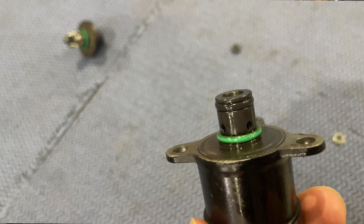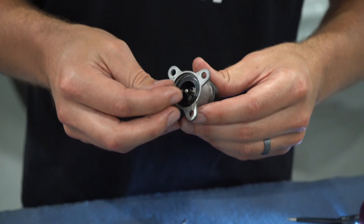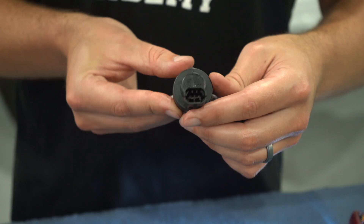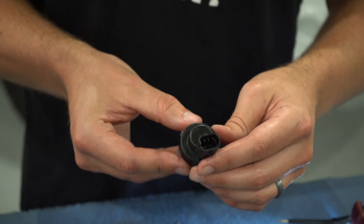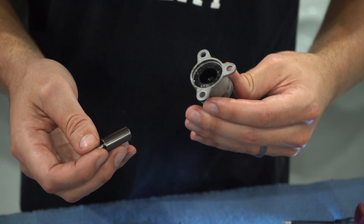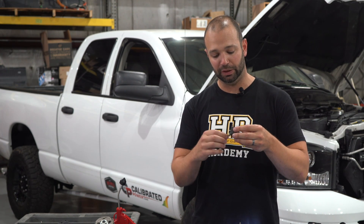We have this end here that's pressed into the housing. The housing is basically a solenoid. If you look in the housing, you'll see an opening. On the end is a two-wire plug — that plug just has two leads on it. Inside that housing is coiled wire, and inside there drops this pintle piece. I'm not sure if that's the exact name, but it resembles a pintle to me. When that coil is energized, it forces this pintle out.